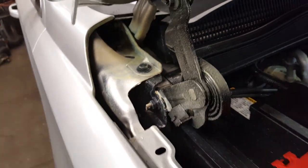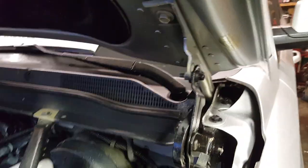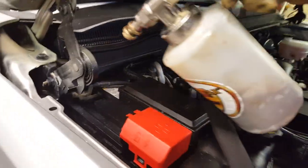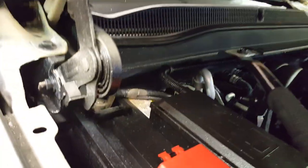If you want your vehicle to last, you've got to spray it with wool wax from Kelsport Products. They sell the clear product that has a bit of a yellowish tint, and if you're a fussy hot rodder, they also sell a black-tinted product — but we just used the yellowish one. I'm going to spray the dipstick tube for the transmission. Everything gets it — everything — because you don't want your vehicle to rust. There's only one way to stop it and that's wool wax, which also comes in spray cans.